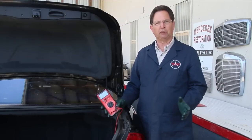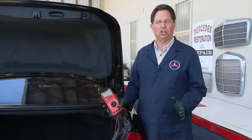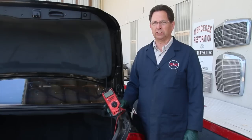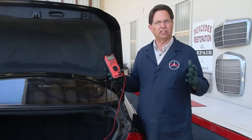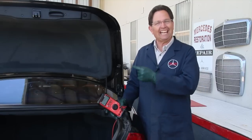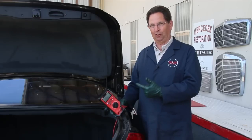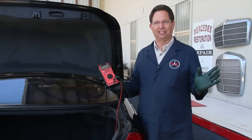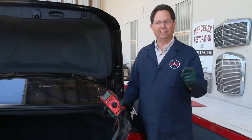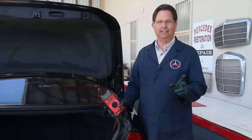Since this is my own car, I'm not going to run out and buy a battery until I check the voltage output of the charging system. This is really critical — extremely critical on these newer cars with a lot of computer equipment on board — that your alternator is producing adequate voltage and current. If not, any heavy drain on the battery could cause a loss of power to the computers and you're going to have some weirdness happen. That's exactly what happened on this car. I was driving and demonstrating to a friend how much power this thing had. I literally floored it, and shortly after, a bunch of warning lights came on the dash — a really good sign that the computer freaked out, and a lot of times that's due to low voltage. It was two days after this happened that I was stuck with a dead battery. So I did get fair warning something was going on.